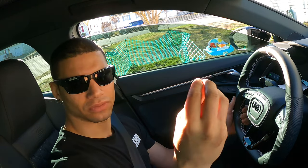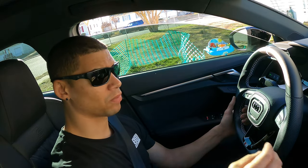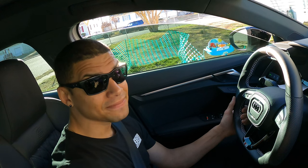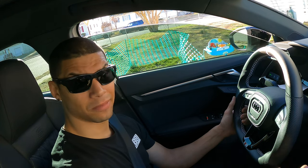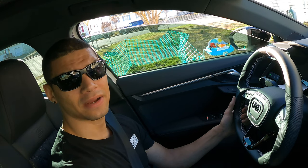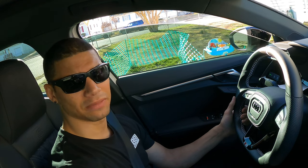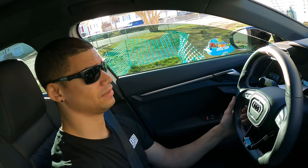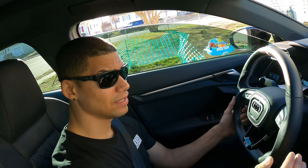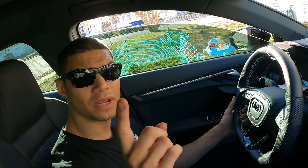You did things the right way, so I'm going to give it a thumbs up. I don't really know about the throttle pipe honestly — the pipe going from the intercooler to the throttle body. I might get it eventually, but I never did it on my MK7. I was pushing 42-43 pounds at one point on the beta turbo from EQT and it never seemed restrictive enough to need replacing, so I don't think it'll need to be on this either. That's my two cents — let me know what you guys think. Thanks for watching — look out for the next one and I'll catch you on the flip flop.